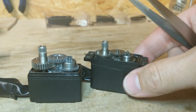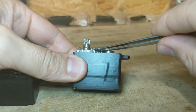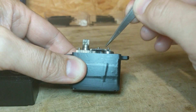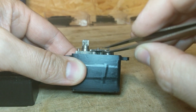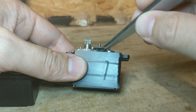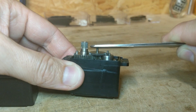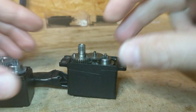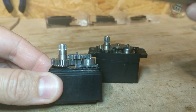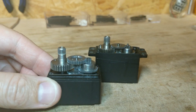In the older model, it has the same issue with the stacked gears, but it didn't have strong enough teeth to start. The third reduction in this model has a very, very thin gear, and these teeth just don't hold up, especially in your crawlers and rock bouncers. You can see in this newer design that they really beefed up the gears to try to make it hold up to the crawlers today.